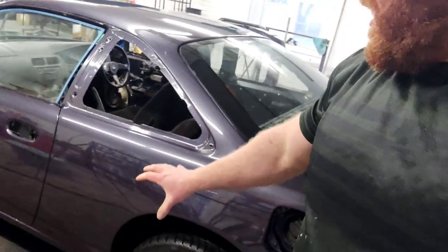A lot of guys doing these types of repairs — whether they burned through somewhere or they're doing detail work — run their tape right to where they stopped the clear coat, and then you're stuck doing 30 minutes to an hour of wet sanding and polishing. That kind of defeats the purpose of a smart repair because you're actually taking more time than if you'd just resprayed the whole panel. If you get a little bit of clear coat overspray on clean unsanded paint, it'll buff right off. Give it a day, or UV bake it for about 30 minutes, let it cool down, take a little compound over it by hand — not with a machine — and it'll shine right up.